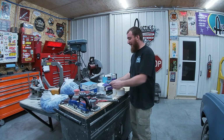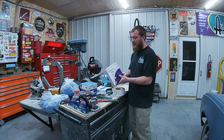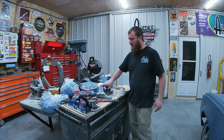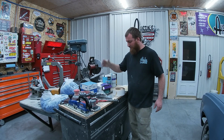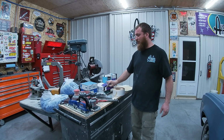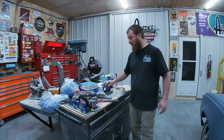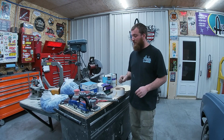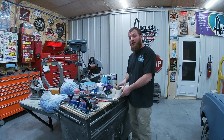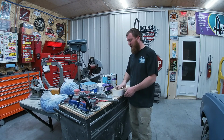Then we dive up into the 8-inch, 3M Stikit. I got some 36 and then some 80 grit. Just get those at the local parts store. You don't go through a ton of those. The 36 grit, if you're careful, that piece can last you a long time, a really long time. And I'm cheap. I can get them off and stick them back on. You can get a lot of use, is what I'm saying, out of those things. So these last a long time.